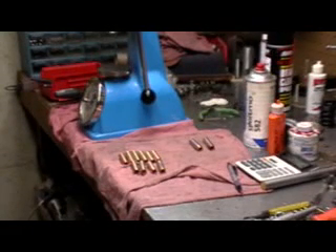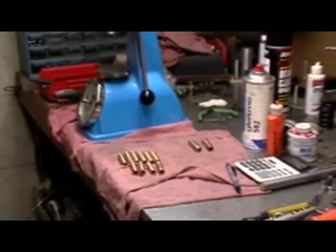We're going to size some Porsche guides for the heads. Got a set of heads in, so we're going to get those done. These are second oversize, so they're 522 thousandths and we've got to take them down to 514.5. I'll show you how that's done.